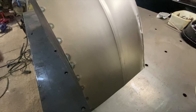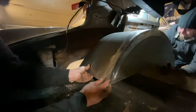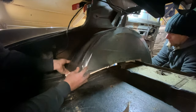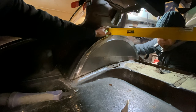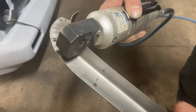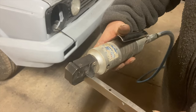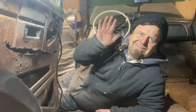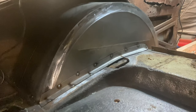Once we've got the tub sitting where we need it to be, we didn't just want to weld the tub directly into the car. So we decided to fold up some angle out of sheet metal and shrink and stretch some finishing pieces around the outside. We've got our little joggling tool out which punches holes in the material. Once we've got all this fitted in place, we can plug weld through those holes straight to the body of the car and also to the tub. Not bad for a couple of hacks — I think it turned out pretty good, to be quite fair. Wheel tub city.